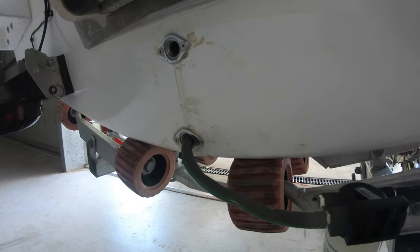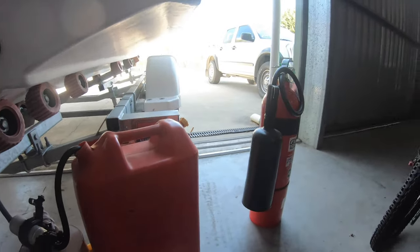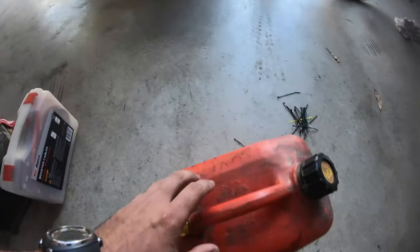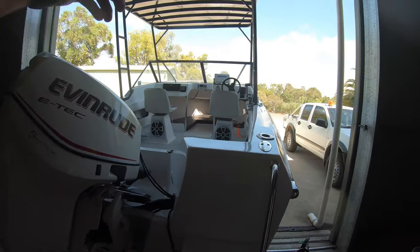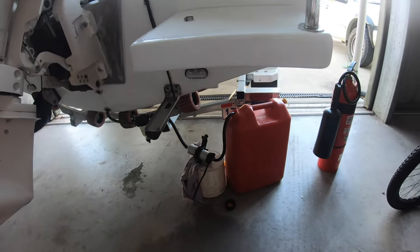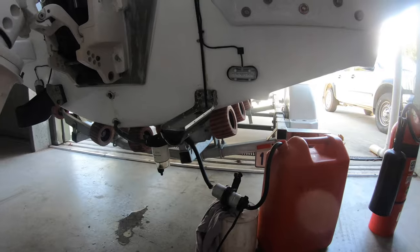Here's the basic setup: it comes down to a fuel separator that pumps through to just another jerry can. I've got a fire extinguisher just in case. We're going to hook it up to a 12-volt battery with some jumper cables. We've got about 10 litres of fresh 98 fuel here — we're going to throw that straight into the fuel cap, and it's just going to pump down through the fuel separator into the jerry can. Hopefully we can catch that last bit of water and debris that's sitting inside the tank.